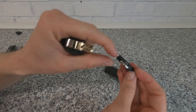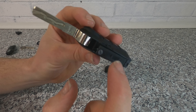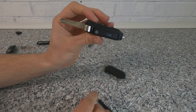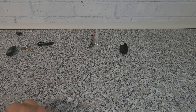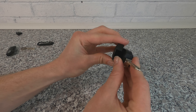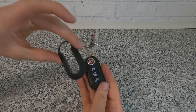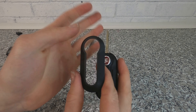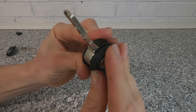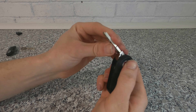Once the key is clipped together, don't forget to put the small screw in the back and tighten it up. Then put your battery back in — just pull the access door out, put the battery in, come in at an angle, make sure it's flush at the bottom and push it closed. It only turns half a turn. Then reattach the new casing to the back — it all just clips together nicely like a shell, keeping everything neat.